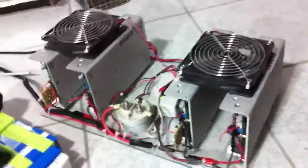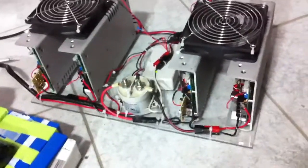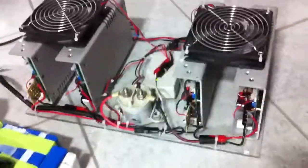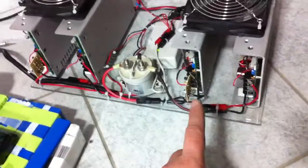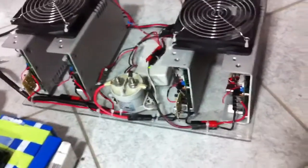When I use a timer on my car to charge my battery — I currently don't have a BMS installed yet, I am working on that — I have this set to charge the cells to about 3.5 volts a cell, which has worked relatively well. Everything stays within balance, pretty much. I set the wall timer, and what happens is it activates the 12-volt supply, which activates the contactor as these power supplies are basically turning on and charging up. It all happens within a couple of seconds. I think these do get some juice before the contactor kicks in, just because the caps fill up, but it's worked relatively well.